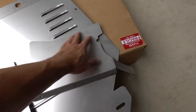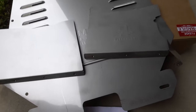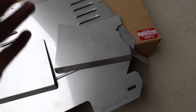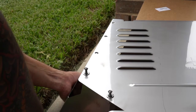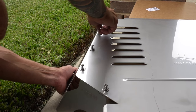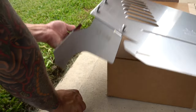The driver's side is a little different than the passenger's side. There is a bit more of a cutout in this shield. Miller Cat designed that cutout so you can actually see the driver's side cat when you go to have your car smogged — anticipating future smog inspection requirements, particularly for California. Miller Cat recommends installing everything by hand, but as a professional I'll be using power tools, just being careful not to strip anything.